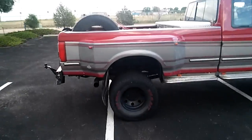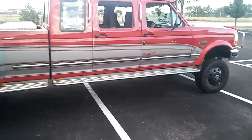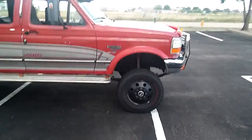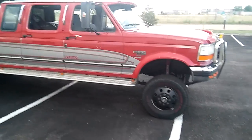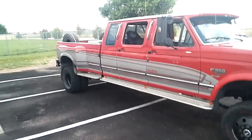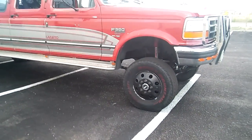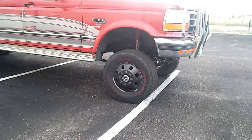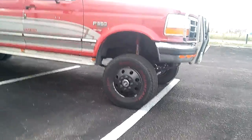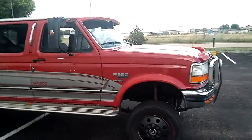A lot of guys you'll see, they'll do the reverse shackle kit, the X codes, J codes, Super Duty leaf spring. And if you've got the money to spend and you want to just drop money on it, this is how she's going to look. Those are 265/75R16s, and the bottom of that truck nearly clears, at probably about 4 or 5 inches, and it'll clear that tire.